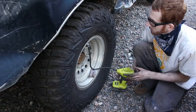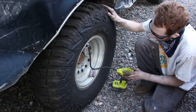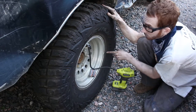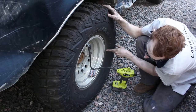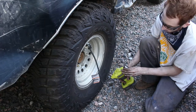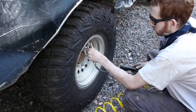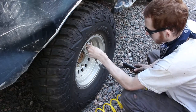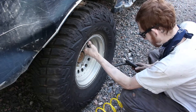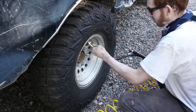I almost forgot — one last thing I'm going to do to get ready for this emissions test is air up these back tires as much as they can go. It looks like it says 35 PSI. The noise on this air compressor is pretty unbearable. The main idea behind airing up the tires is to decrease rolling resistance. The lower the tire pressure, the more the tire flexes as it rotates, and that's causing work on the tire — heating it up and wasting energy. It's like if you have a close-to-flat bike tire: it's a lot harder to pedal than a really firm bike tire. Same principle.